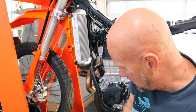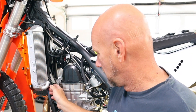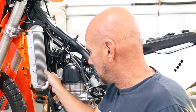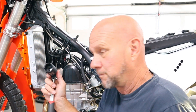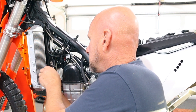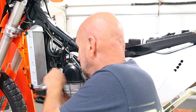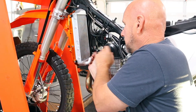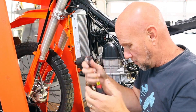What you need to know about changing the tube: you'll have to take off your coolant lines — there's one that comes out here, one that comes across here, and a small plug for one of those canister drain lines that's kind of in your way. Take that out, then use a 30-millimeter six-point socket to get this thing out. Some people just grab it with pliers, and that's fine too, though I personally haven't been able to do it that way without screwing it up. This one threads out, the new one goes in, put it back together and run it one more time.